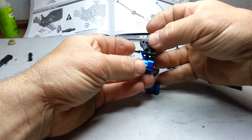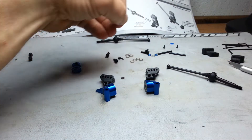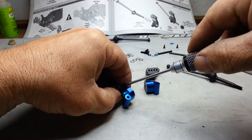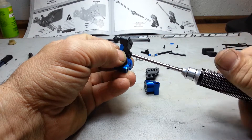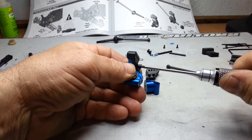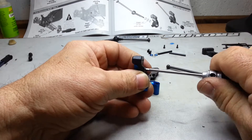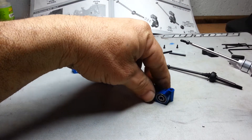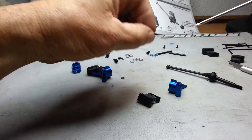I just like the feel of the car — it makes the suspension roll just a little bit slower. The way these go on is they actually will go the direction — you can see there, it just kind of chases the direction of the aluminum hub. Nothing to it, put a little bit of loctite on here and get this started. You don't want to use a whole lot of loctite on there because you may want to swap the hubs around. Just enough to keep it snug — don't put so much on there that you have to break a wrench trying to get it out.